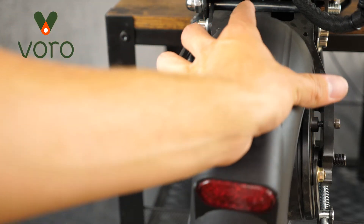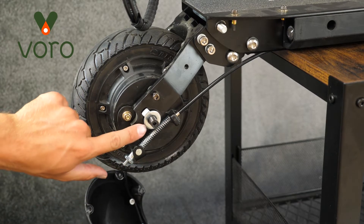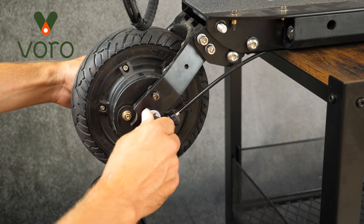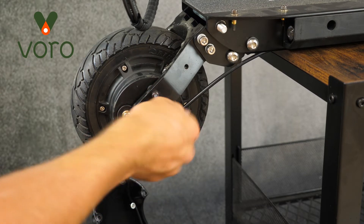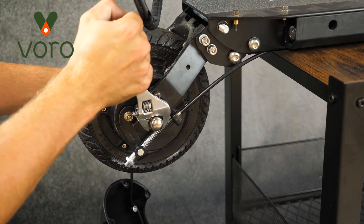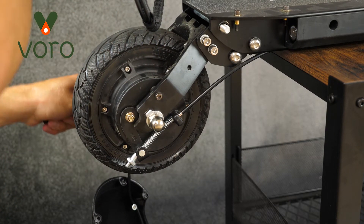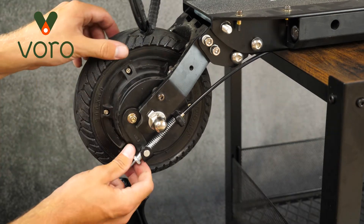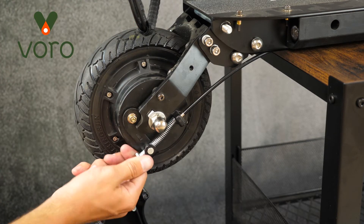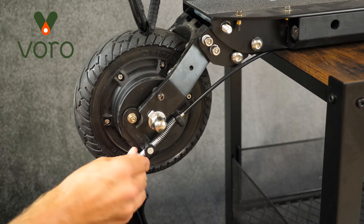Now you can see just how the fender attaches to the scooter. Before moving on, let's make sure that our rear wheel is fully attached. Go ahead and slide on those washers — they'll only go on one way — and then tighten down the nuts on each side of the wheel. Don't tighten them completely though. I recommend tightening this little screw with your Allen wrench first, get that all the way tight, and then you can fully tighten the wheel nuts. To adjust the brakes, go ahead and spin the back wheel while also spinning this little barrel adjuster. Once you feel your brakes start to make contact, loosen this barrel adjuster until they stop making contact and your brakes are adjusted.